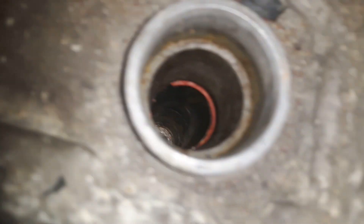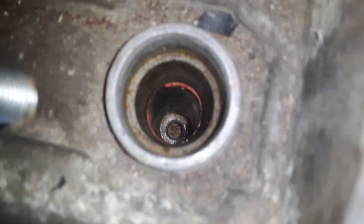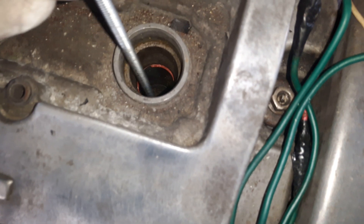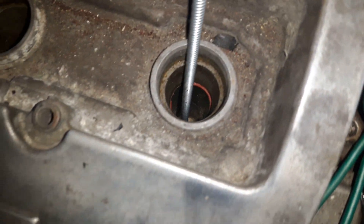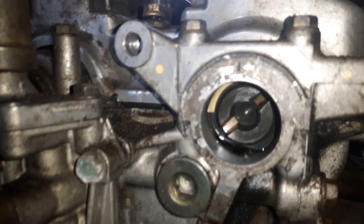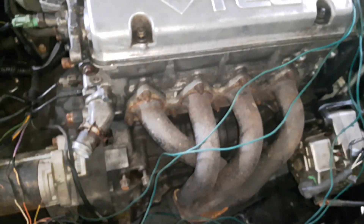I've put it to the very top and stopped it. You can practically see the tip of the piston right there through the small hole — that's the top of the piston. So I'll put the rod back in — it's right there at the very top. This is how it is right now, so we leave it like this and go back to the distributor side.